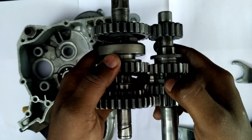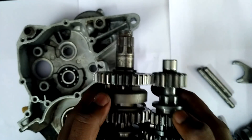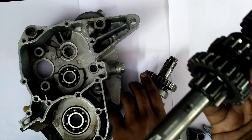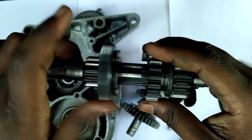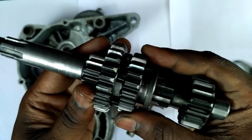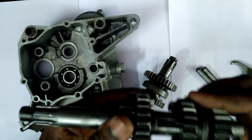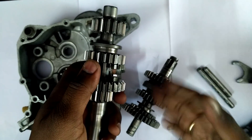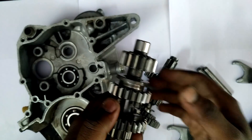So now the second gear is always in contact with the shaft. To put it in simpler terms, all the gears are interconnected always — hence the name constant mesh gearbox. The only thing which happens is when you select a gear, the respective dogs move up and down. On the driven gear side also there are two dogs — one is free and one is connected to the shaft. When you select a gear, this dog goes and catches the other one so it becomes connected.